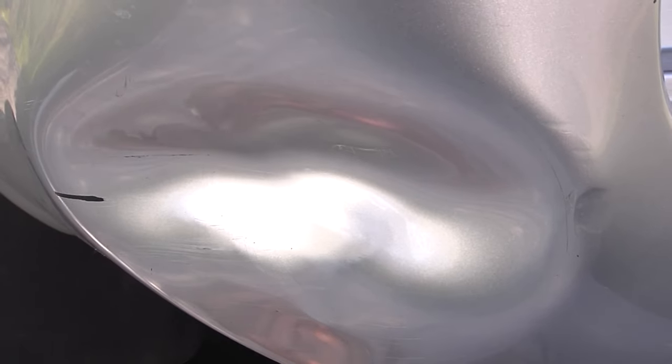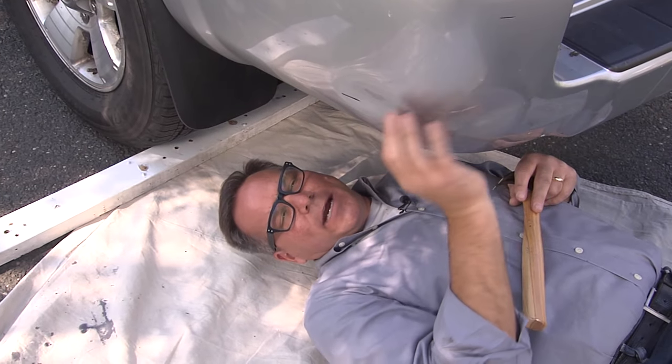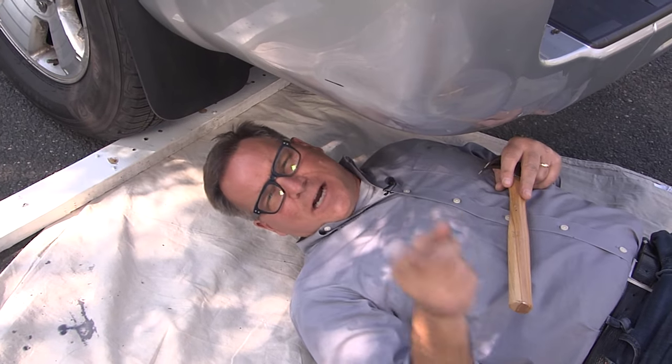You may get a little cracking on the paint when you do this, but it's way cheaper than having your money go to an auto body shop just to pop out a dent like this. Now you finish that out, it pops out, and this plastic has memory, and eventually this will kind of even all out. Look at all the money you saved, and you fixed it in 15 minutes. Try to be careful next time.